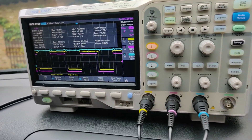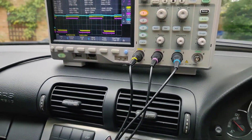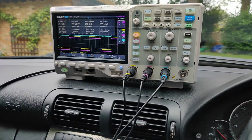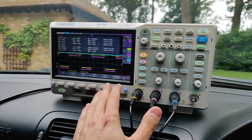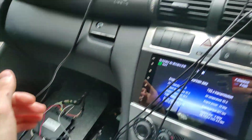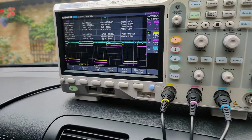I'll go back into park for now. But yeah, this is what I've been doing today — pretty much just probing all the solenoids on the transmission, and I've got a good idea now as to how they work. All the PWM signals need to send the correct frequency, which is 1kHz for all of the solenoids on the gearbox. They all operate at 1kHz.